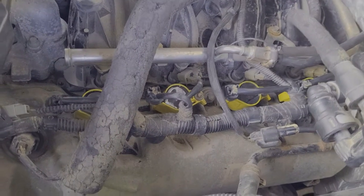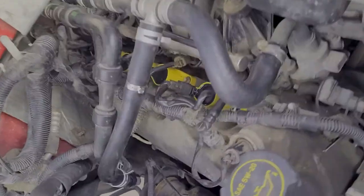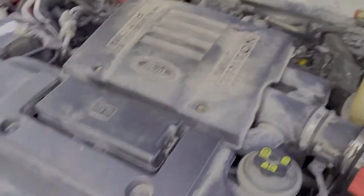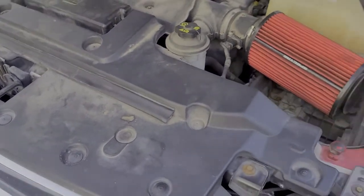Just like that, we've got four new coil packs and spark plugs on the driver's side and four new coil packs and spark plugs on the passenger side. This is a pretty universal process when it comes to changing your spark plugs and coil packs — it gets better gas mileage and better performance. One issue people run into is debris caught in the spark plug cylinder well — just shoot some carb cleaner down in there, let it soak about 15 to 20 minutes, then go in with your socket and work it around to get a nice good connection. Be patient — take your time and it'll all work out. If you have any comments or questions feel free to reach out. Hope to take a minute out of your day to do some maintenance.